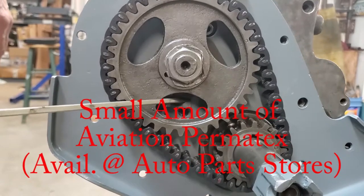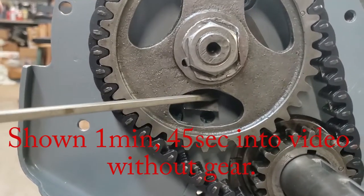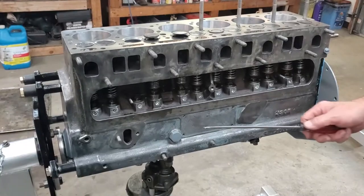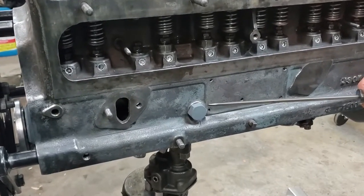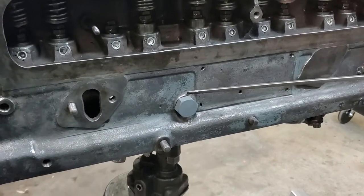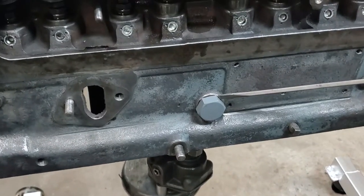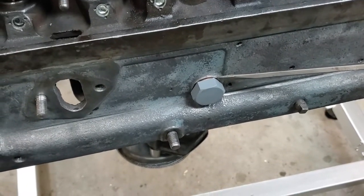Here you have the little camshaft guard and oil slinger piece with three fasteners — that's all you need to fasten your front motor mount for the time being. This is your oil pressure regulator. Your oil pressure is theoretically set, but you can add washers between the cap, spring, and plunger if needed — you won't know that until you run it. The most important thing right now is to put a new copper washer directly behind this piece as your seal. Do not reuse a copper washer.